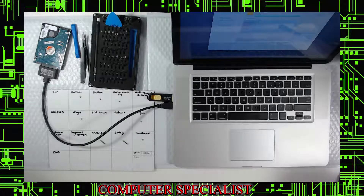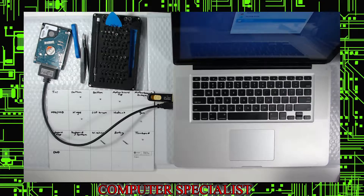Okay, there it is at the end — you can see it's verifying. That took about 10 to 15 minutes; this customer didn't have much data. Every machine is different — if you have a ton of data it could take an hour or two. Once it says Done, click Done, click the red X, go up to Shut Down, and shut it down.